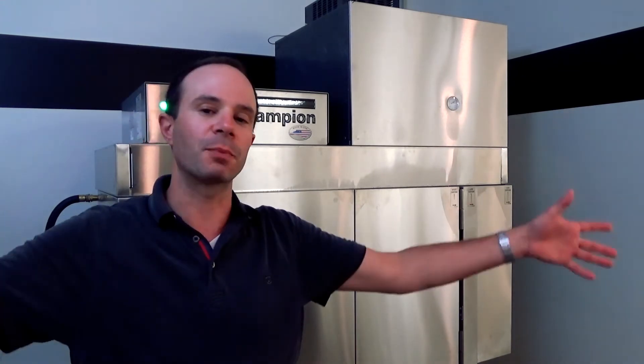In the case of a batch-style machine like an under-counter or a door-style machine, we'd need to let it run its first cycle, open and close the door, then start a second cycle and run it completely. NSF understands the mechanics of how dishwashers work — we're not just heating up water, we're heating up all this stainless steel. When that wash pump comes on, we spray hot water over cold stainless steel which absorbs a lot of that heat, so they're allowing us to warm up that metal as well so the machine can hold temperature.